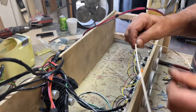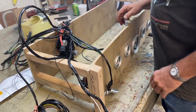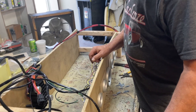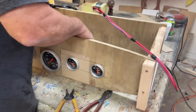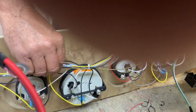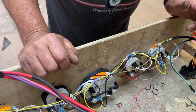You cut off some extra coil wire — it's for the tach. It runs out here to the engine loom and goes to the tach. It's a different color on this kit than normal; the set we used to use had a purple wire for that instead of white. It goes to the coil. Anyway, it's a nice kit. Joe's gauges are about ready to go into the car. I've got all this as neat as you can get it, running everywhere for all the lights, and then we'll have the GPS signal sending that goes into the speedometer.